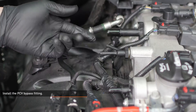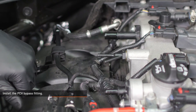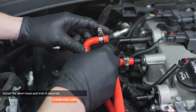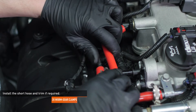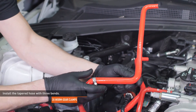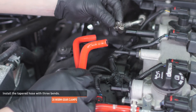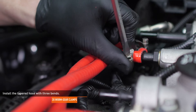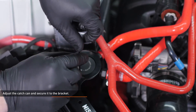Depending on your vehicle, the fitting may point towards the front or rear of the vehicle when tightened. There is a provision on the hose which allows this fitting to face in either direction. Locate the short hose in your kit and install two worm gear clamps. If your valve is pointed towards the rear of the vehicle, install the short end of this hose to the angled tube on the valve and use the full length of the hose. If your valve is pointed towards the front of the vehicle, install the hose in the same way and then trim the excess hose. Locate the tapered hose in your kit with three bends. Install a worm gear clamp over the wider end and slip it over the fitting marked on the catch can. Slip a worm gear clamp over the other end of the hose and install it to the straight tube on the PCV bypass valve. Now tighten all six clamps to secure the hoses. Turn the catch can until the lines flow smoothly, then tighten the two bolts that secure the can to the bracket.